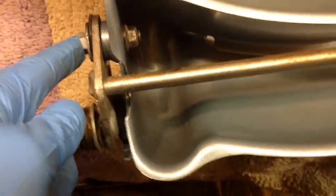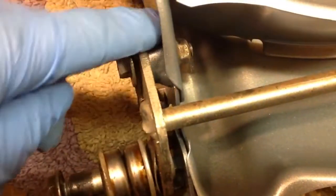I sometimes strip down and paint up the decks on the old Sovereign, Champion type mowers, and the front wheel mechanism is a lot more fiddly to put on than on this. All it is is one nut and bolt there, one nut and bolt there. Just got to make sure you get the height adjuster thing right. That is all right, and like I mentioned, them spacers being welded on really made it easy. It's all tight now. All I've got to do now is just grease the bearings, put them back on the wheels, bolt them up. That's the front axle done.